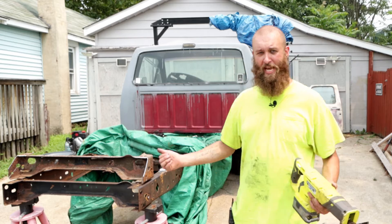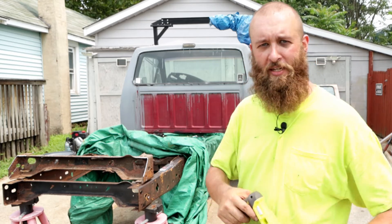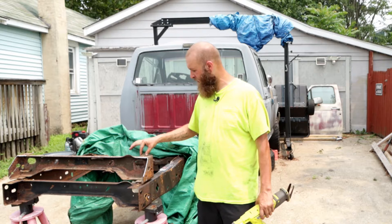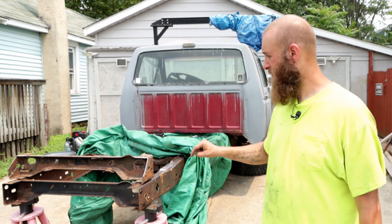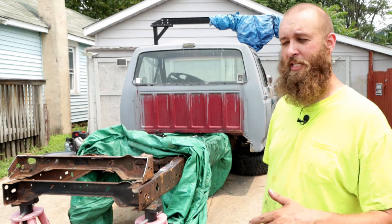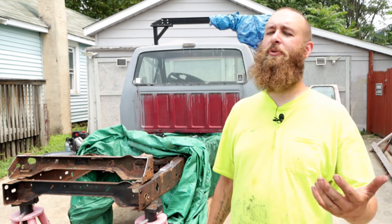With $10 for the actual piece, I'm able to salvage and basically recycle a part that would just rust away anyway, and save myself so much money. I'm going to grind these rivets off, separate this piece from the two sections of frame, get rid of them, and then use bolts in place of the rivets to hold it in place on my frame. This one seems like it's in decent enough shape — it just needs minimal repair — and I'll paint it and do surface rust removal like I'm going to do with the rest of the frame. We are now going to be starting to move forward with this project because I've got everything I need, at least for the rear half of the frame.